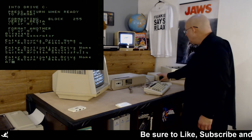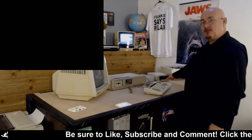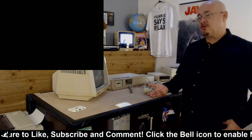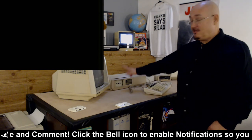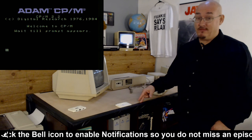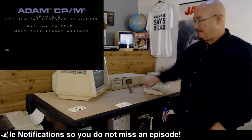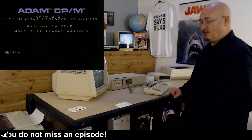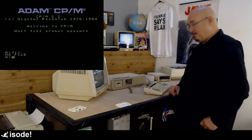So let's shut the floppy off. No disk was in there so it couldn't boot there, so it's going to boot from here. If you had an older 8-bit computer like an Atari or Commodore that used cassette decks, you were used to really long, slow load times. This data drive is actually comparable in speed to the disk drives of the Commodore — it's actually faster than a Commodore disk drive and almost the same speed as the Atari disk drive. The only issue is the seeking time to go find it; once it finds it, it loads fast. And as you can see, it's booting up CPM right now. There's nothing on here except the system, so if I do a directory, there's no files.